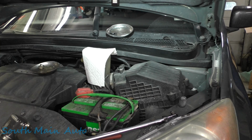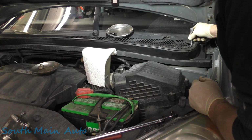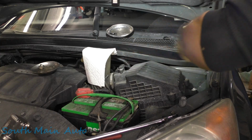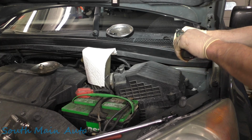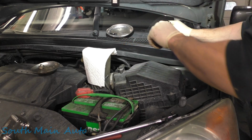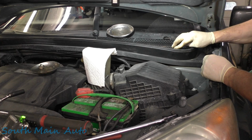And of course, torque to the factory specs, you know me. That piece of hanky. And that one goes right down there. That one we have to run all the way by hand. Let's grab our torque wrench here. Click. There's one. There's another. There's our third one, so that's good. 51 foot-pounds on those little fellas. And then we gotta click these back in.